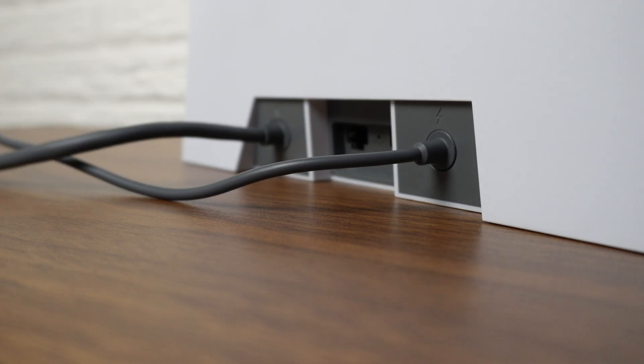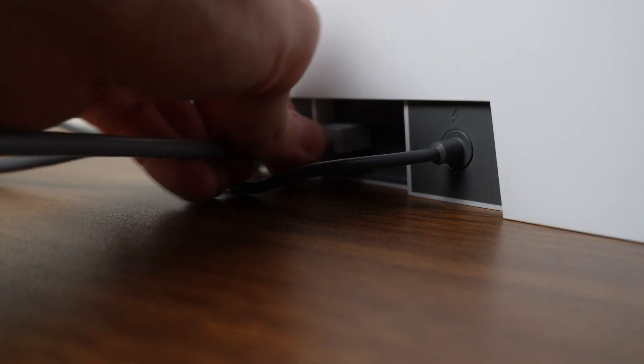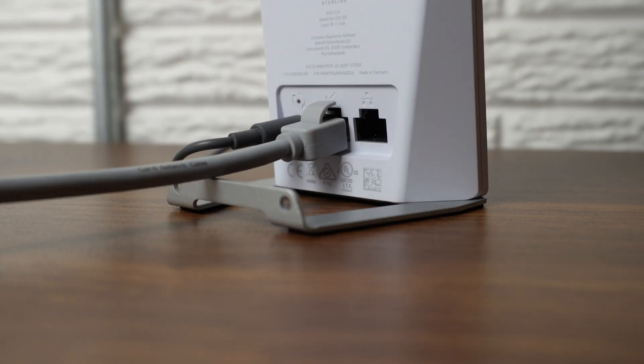That's all there is to it. I've just installed a wireless mesh network with Starlink by adding a $40 router mini mesh node to my system. It was super easy — just plug it in and tap one button. If you're wanting to do a wired system, pairing is even easier: just connect an Ethernet cable from one of the ports on the back of your main router to the dish or antenna port — that's the WAN port of your mesh node. Whether it's a router mini or Gen 3 router, plug into the leftmost port and that'll create a wired mesh connection instantly within the Starlink app. No additional steps or configuration needed.